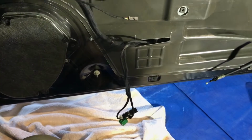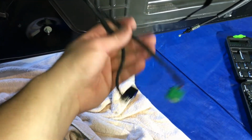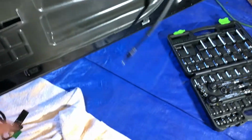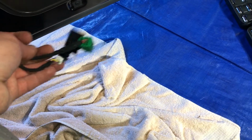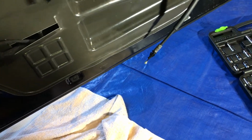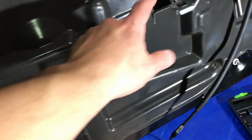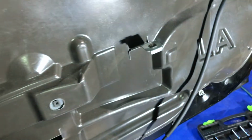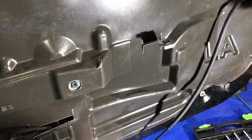I might want to mention with the shaky cam again, you have 1, 2, 3, and a cable for the door handle that are all dangling, and these all hang below the door level. So if you go to shut the door, you're obviously going to get them closed in there. What I recommend is taping them all together. I don't think you should tape to this because this is only foam, but tape them to here. This way they don't fall down. I mean, you could try resting them up here or stuffing them in somewhere, but I think it's best if